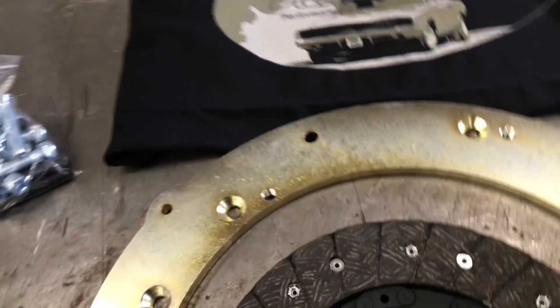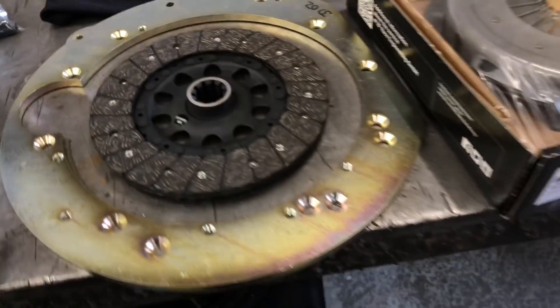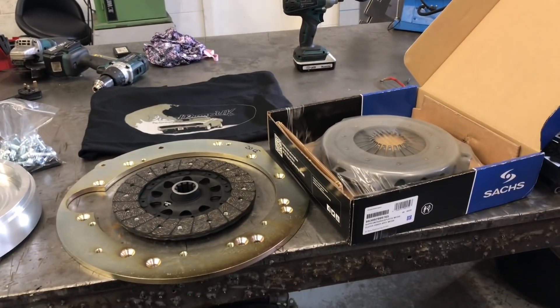This is our latest generation of the BMW kit and they all come with those features. It's a really nice, simple, easy way of getting the two items bolted up. I did a little video showing how to adjust your clutch pin pivot because that is a little bit different to your BMW standard. It uses a standard BMW release bearing and it's quite a straightforward kit to fit. The good thing is if you break a gearbox you can swap it — no heavy flywheel issues, and the bearing issues we had in the beginning with the spigots have been resolved by going to rollers.